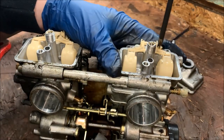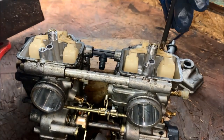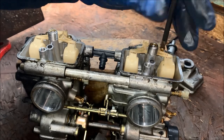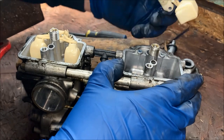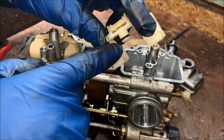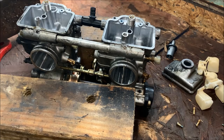When doing this, don't use power tools — do it by hand, because if you use a power tool you'll strip it out and then you'll be in for a world of hurt. We took that out, and now we're going to pull the float bowl assembly out. And there it is — that's the O-ring that fails on it. We'll get more into that.